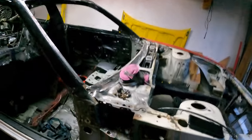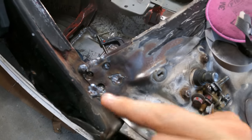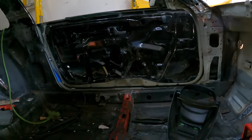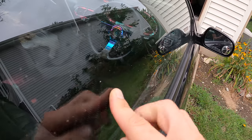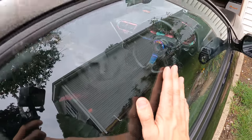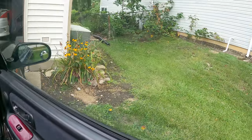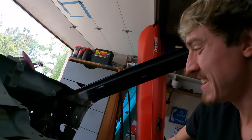Well, since we're making such great progress, let's continue progressing on this A-pillar. Right off the bat I'm going to finish filling in the spot welds here. I need to figure out this little section that's just open. Before I start welding, I just remembered — since I put that door on, that means there's glass there, so I need to cover up that glass. If you don't cover up glass when you're welding or grinding, this could be what happens — there's little dots in the glass on this car because I did not take out the windows when I was welding. You can't even see it in the video but you can feel it. That should be good enough — let's get to welding.